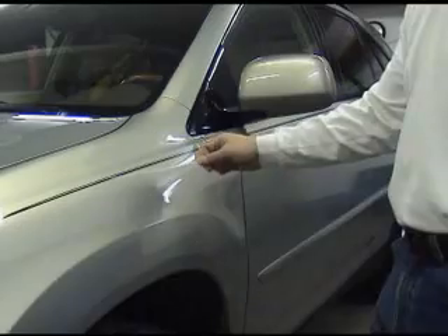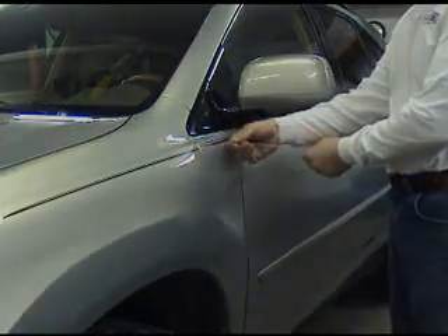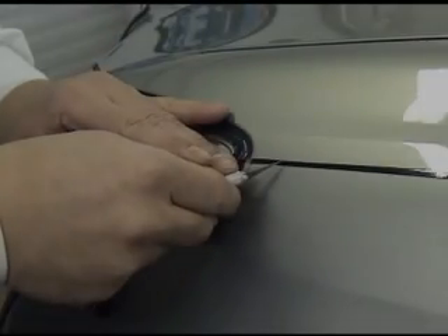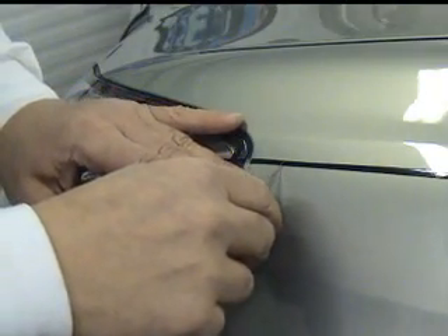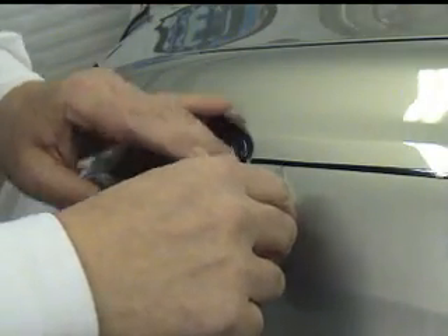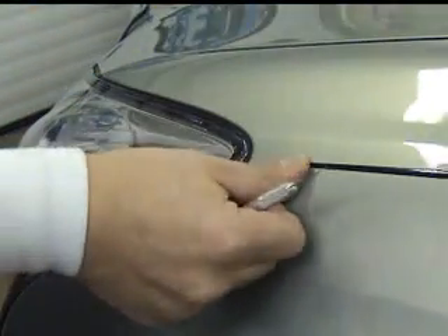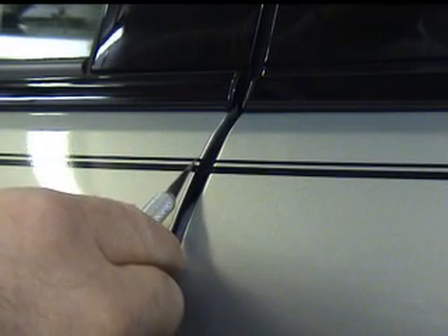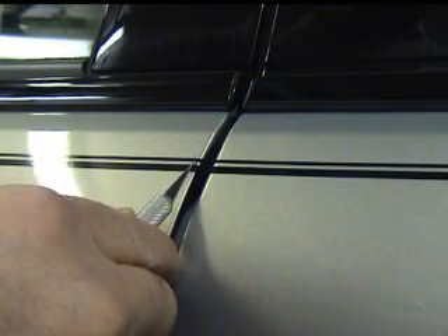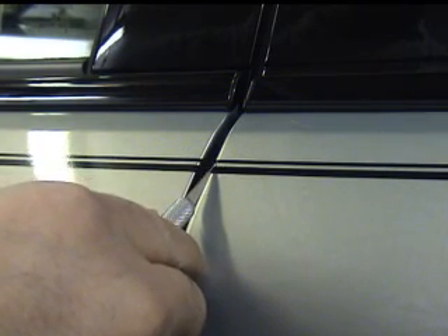With the front part of the stripe pinched, we're now ready to remove the clear protective covering and trim the pinstripe. With the clear covering removed, trim the front approximately one inch from the edge and trim with a nice radius tip as shown here. We do not suggest wrapping pinstripe into door jams — trim the stripe at each opening approximately one sixteenth inch from each side.